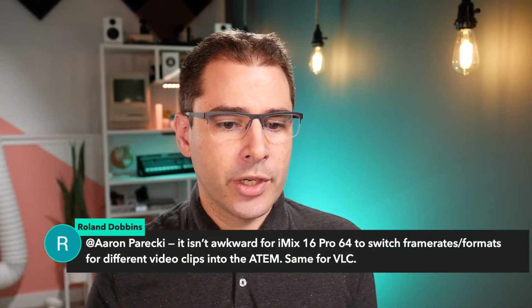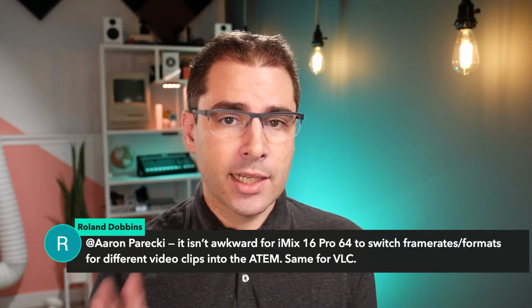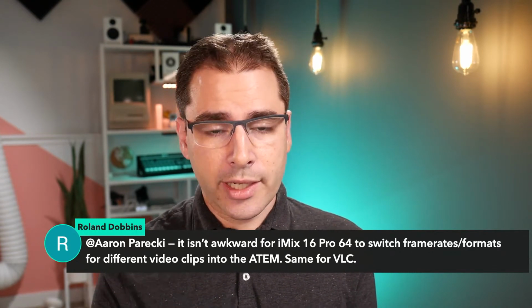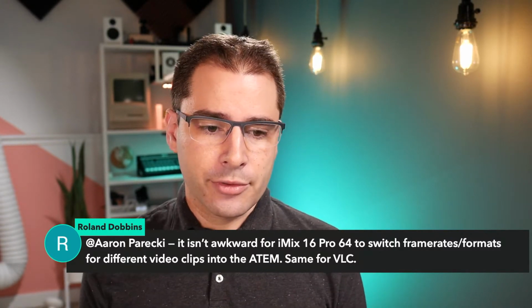We've got, oh yeah, isn't it awkward for iMix to switch frame rate formats for different video clips into the ATEM? Yes, but on an iPad, the iPad is outputting a consistent frame rate out, and it's converting the clips as they're being played back, which is very different from the way the Hyperdeck works, where the Hyperdeck is taking whatever's on the card and setting its output frame rate to that. And yeah, they could build in a scaler the way that the ATEM Minis have a scaler on the inputs. They could add that to the output. But I'm not actually sure that makes sense for the way those work.